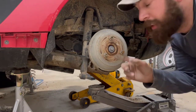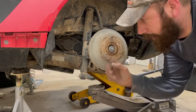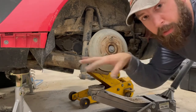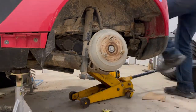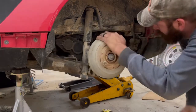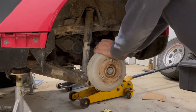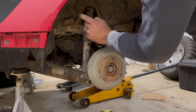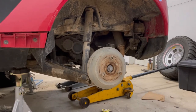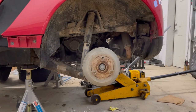What I'm going to do is swap the floor jack to the other side on the wishbone. I had it on this side when I put that side in - it kind of relieves some of the pressure since this whole wishbone flexes under the car. As you can see we've got a good amount of flex in this now, so it'll make this going in a little bit easier.